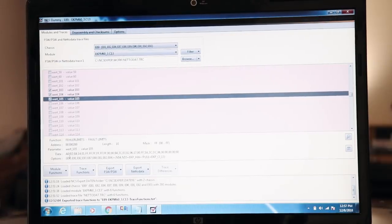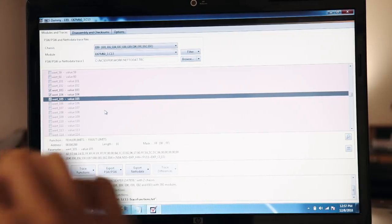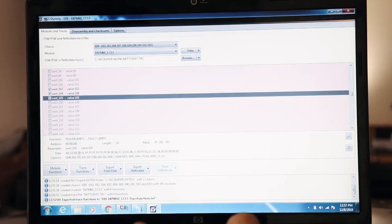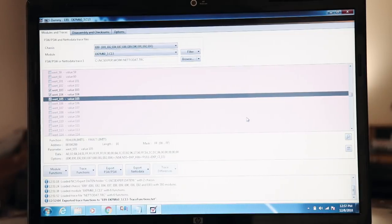That's our address line length. If you take all these individual bytes here, you're gonna have 30 combinations, all separated with commas, okay? Hopefully you guys are with me there and it makes some sense. So now, this is where I've seen some threads about how to get around this issue and people try different combinations. But I've already kind of looked this up. A0 has to do with the high voltage. 1D has to do with the low voltage. B4 has to do with the current on the high side, and 14 has to do with the current on the low side.